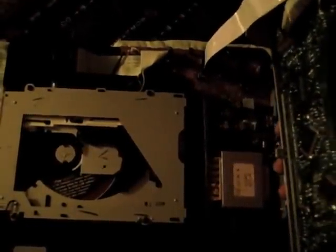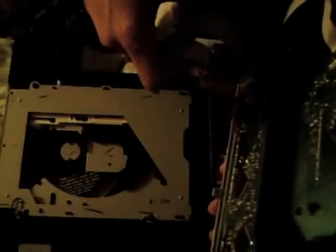After you have the five screws out, flip it back over and this whole top piece will come off. Watch out — there is a ribbon attached right here, so be careful when taking it off. Flip it backwards so you don't mess up that ribbon. The ribbon is also attached to a little hook; you can very gently pull it around that hook so you have more play on it.